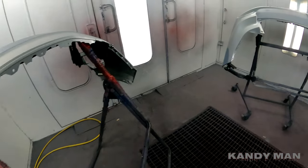We're going to be doing a silver — it's both sides and two bumpers. So we're in the mixing room now, we're going to mix up the sealer first. When you're doing a silver, it's crucial that you get your sealer as close to that color as you can because silvers are very transparent, and you want to get that ground coat very close to that silver. That way you're not trying to cover too much of a darker color or too much of a lighter color.